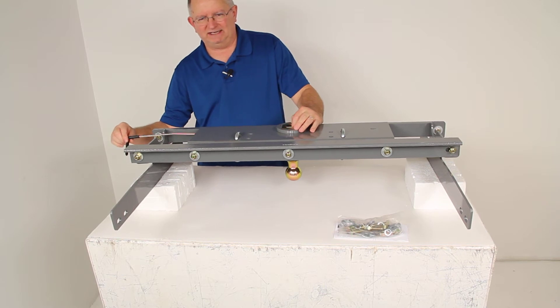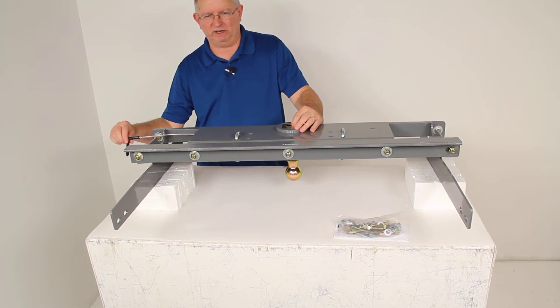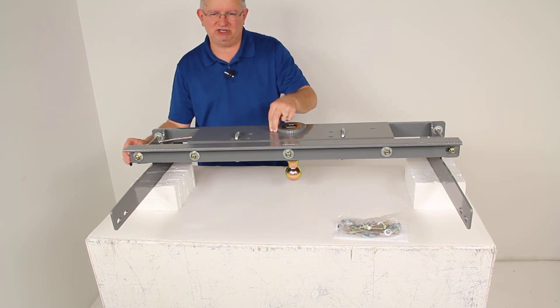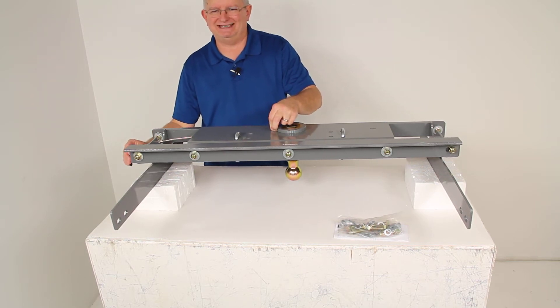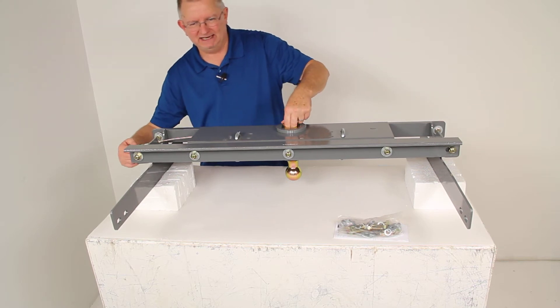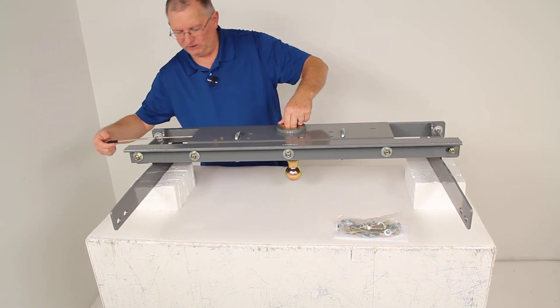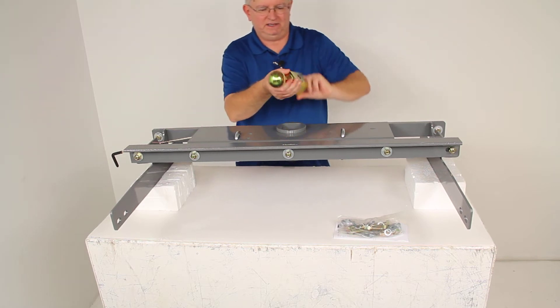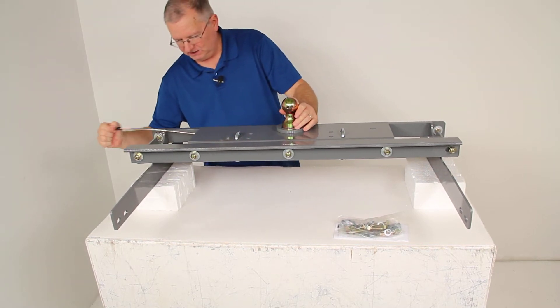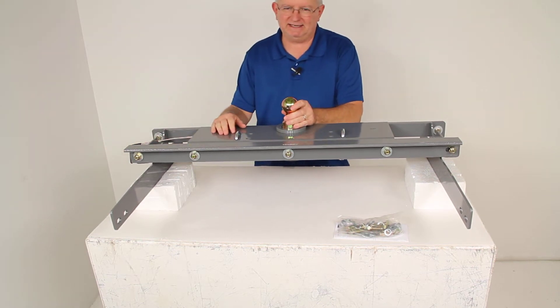This handle right here is accessible at your rear driver's side wheel well. On the very end of this handle, right under here, has a 5/8-inch diameter spring-loaded steel locking pin, which will go all the way through this ball to secure it into place. If you pull this open and twist it, it will lock open and you can turn it over. When you're ready to tow, just drop this in, twist it to release it, and that pin will lock that ball into place.